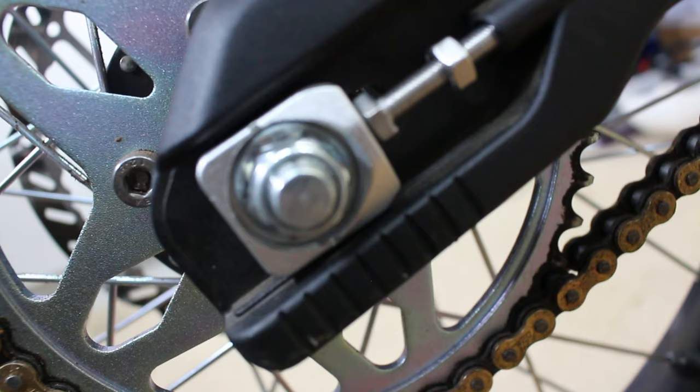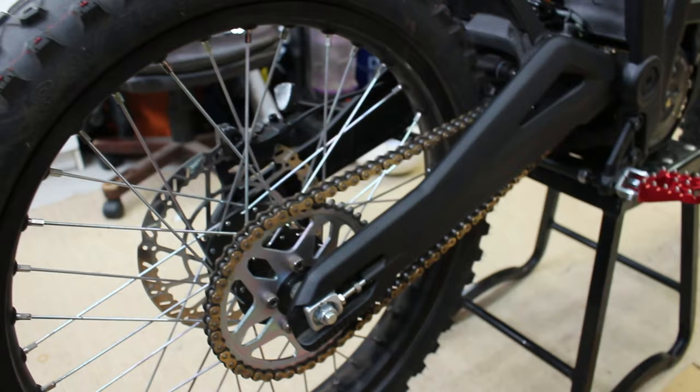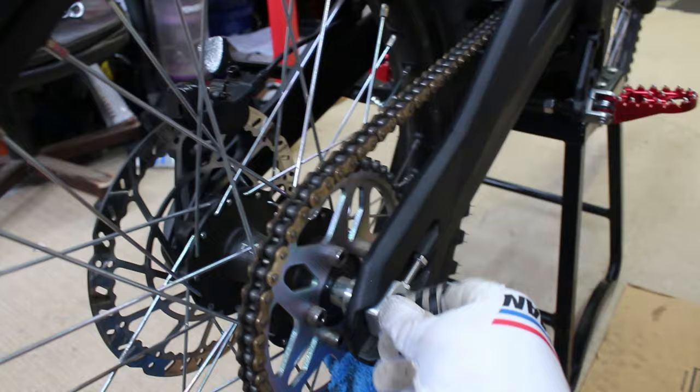Now that I've made my adjustments to the chain adjusters, I've got the right side just a little bit past the fifth line and the same on the left side — just a little past the fifth line. The slack's looking good, a little tighter now — still got about a quarter inch up and a quarter inch down, which is all you need for this bike. When tightening back up, you don't want the rear wheel to move in the chain sliders. An old trick is to take a shop rag, put it in the sprocket, and wind it up into the wheel — this pulls the rear wheel forward so when you tighten the lock nuts and axle bolt, it can't move, ensuring your wheel stays straight.